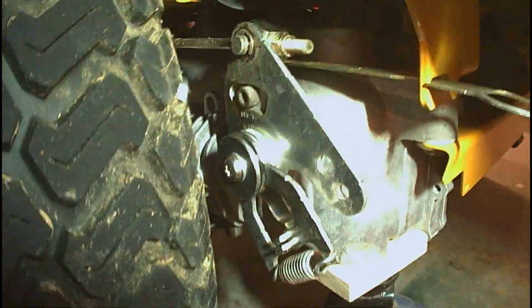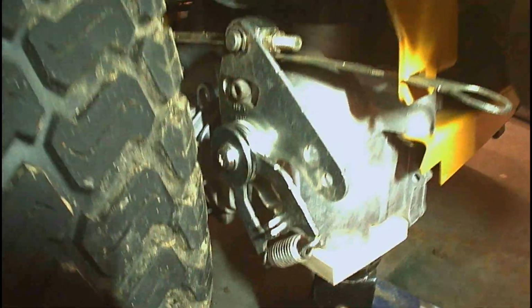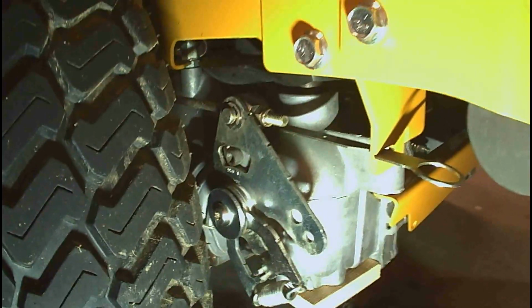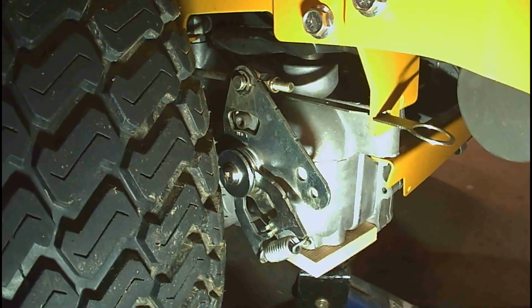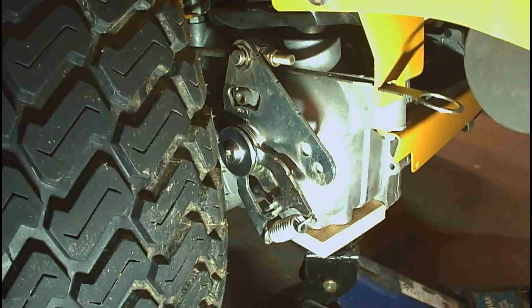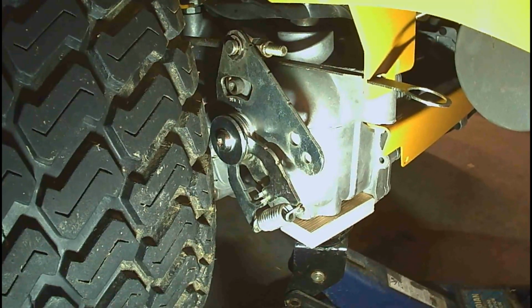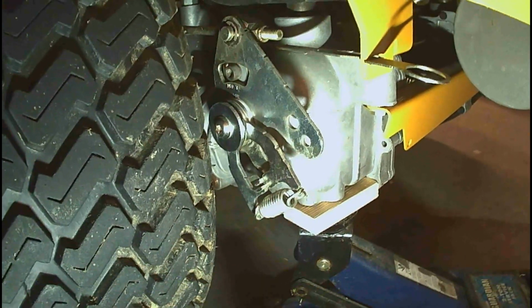You can change the oil and the, let's see if you see back there or not. There's the filter. You can change the filter and the fluid on this thing. And the fluid, by the way, on these ZT2800 and all these Hydro Gears happens to be just 20W50 weight motor oil. It can be straight non-detergent, or it can be detergent oil. Either one doesn't really matter. It's better to put detergent in. I was in the oil business for 40 years, so detergent oil will help keep mechanical operations in business a lot longer.